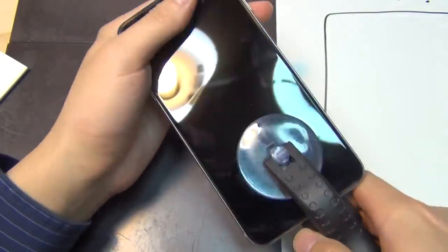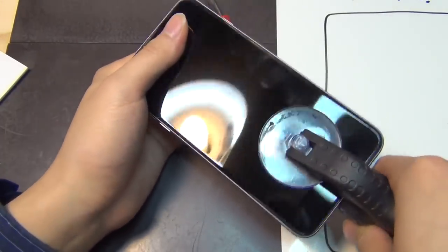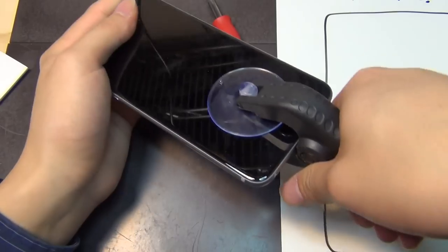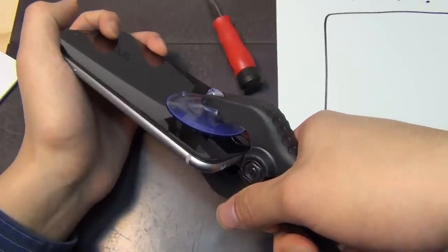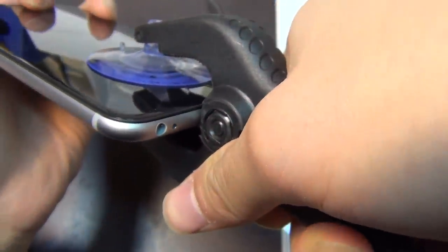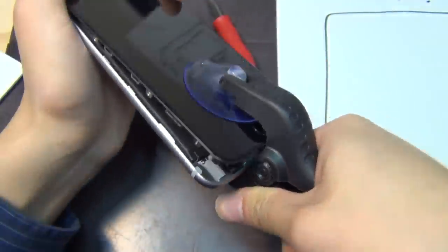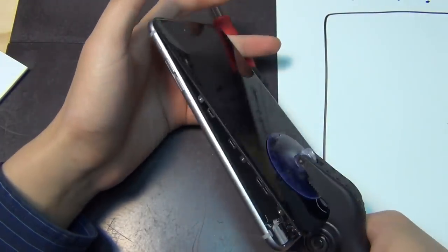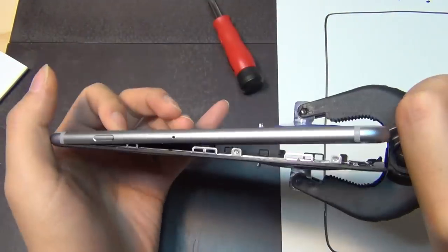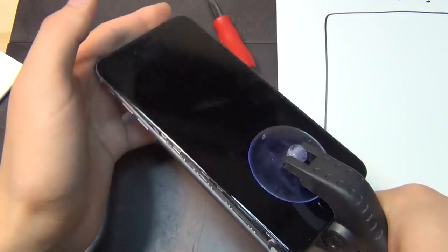You hold the phone in one hand and use the other with the iPhone opener. This phone is barely fitting into my screen — it's so big. You want to pry open gently with the iPhone opener, and you can see that the screen is going to give. You'll get a pop-open sound from the phone, and that's it. As simple as that — it took me like three seconds. You put it on and it opens.